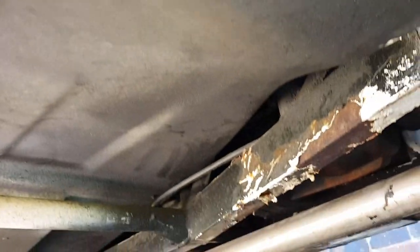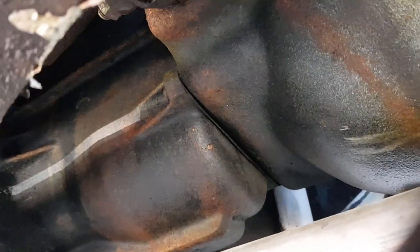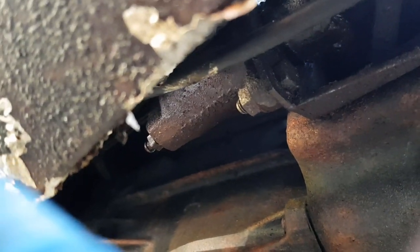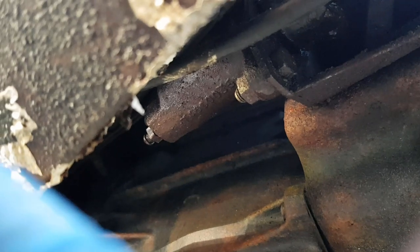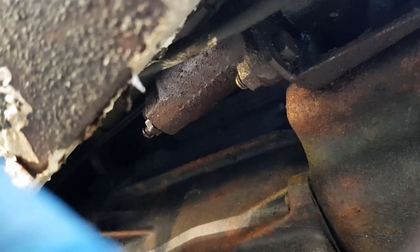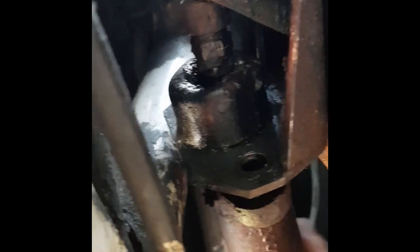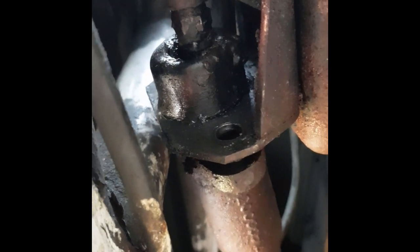It's fiberglass. Okay, so there's the slave cylinder — looks fairly easy to get to. The top bolt might be a little difficult but the bottom one's easy enough, and the pipe should be easy enough on the end. The securing bolts are out, but it's not coming off because the pipe is holding it — it's quite a rigid pipe. So we're going to have to take the pipe off first.